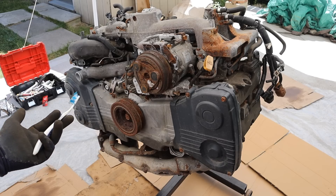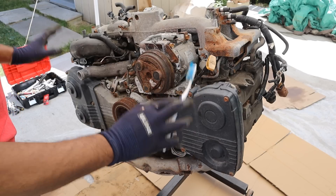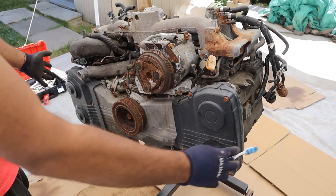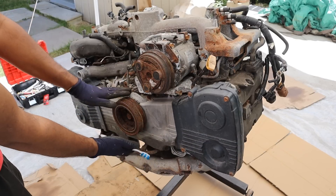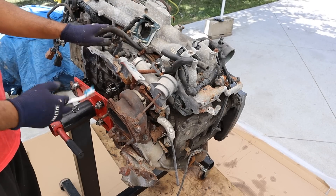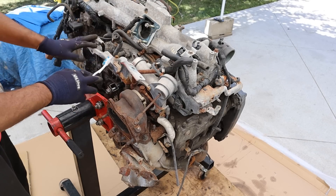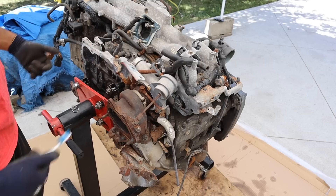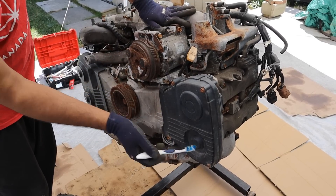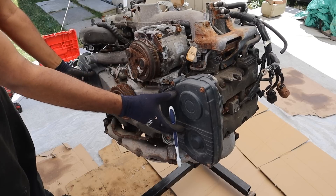Today I'm going to show you what's inside of a Subaru boxer engine and how it works. This is a 2.0L 4-cylinder engine, but what makes it so unique is that the pistons are horizontally opposed to each other, which is what makes this engine so wide yet sit very low for a nice center of gravity in the car. This engine is also turbocharged, being out of a WRX from the early 2000s. We're going to be tearing this thing apart so we can see just what causes these Subaru engines to fail so much. We'll start here in the front of the engine where we have a timing belt that powers double overhead camshafts, with the crankshaft in the middle and the two heads on either side.